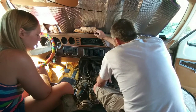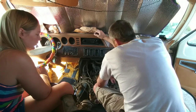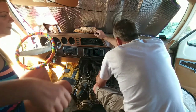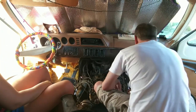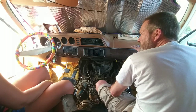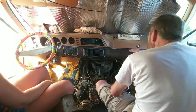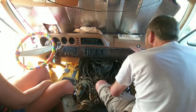And he'd go out, get the carburetor off the vehicle, take it home, just like this guy, rebuild it, bring it back the next day, put it on the vehicle, put a brand new set of spark plugs in it, have him drive it for a week. He'd come back and pull the spark plug out, and if it was running rich, he'd adjust the float level down a little bit, just a 32nd of an inch. And if it was running lean, he'd adjust the float level up a 32nd of an inch. But literally a 1/16 of an inch is the difference in that float level there.